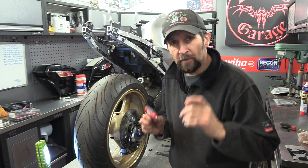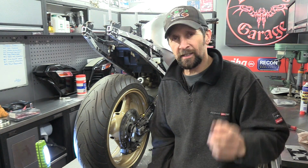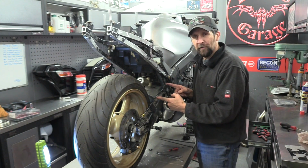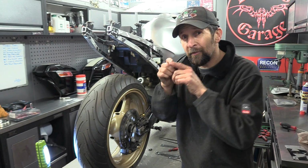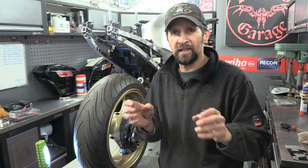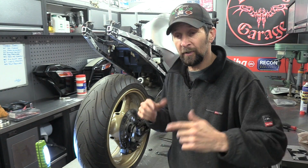Right, now when you get down to those little champagne bubbles, you know, little tiny fizzy bubbles, those are the ones that can take just ages to keep pushing through. If you imagine you had a big blob of air there, you're shoving stuff past it, you're shoving it round corners, you're shoving it round the pistons, you're shoving it out through a bleed valve, and an air bubble just gets fragmented. It gets atomized into loads of tiny little fizzy bubbles, but they'll gang up together in the future as a lump and they'll become one big bubble and you'll have spongy brakes.